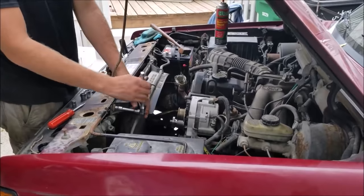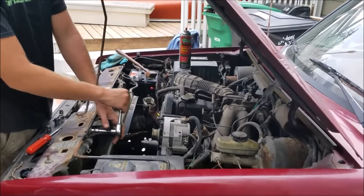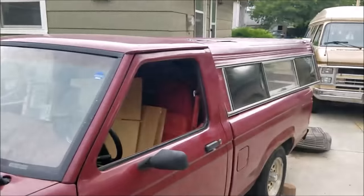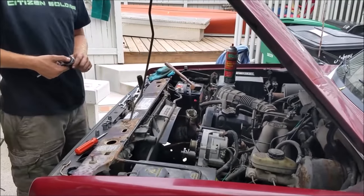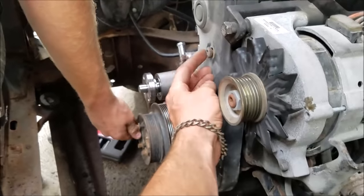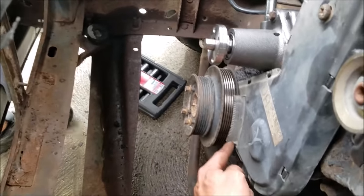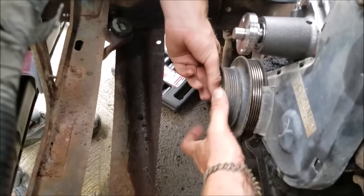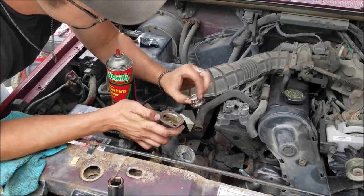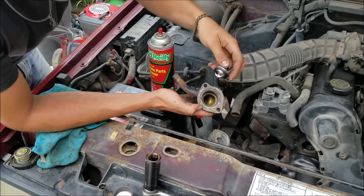People like Rangers and I like them too - that's why we have one. I don't want to own a full-size truck; the insurance is higher, everything's higher. This little four-banger five-speed gets good gas mileage and you've got a truck bed - it's like an El Camino, just ten times less cool. Anyway, we're breezing through the rest of this. We got our cover back on, got this little screw to tighten up yet. The crank pulley goes back on - it has a dowel pin to locate it, which also has the timing mark for setting engine timing, so you can't get that wrong.